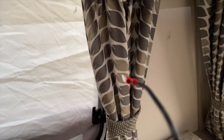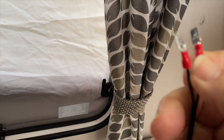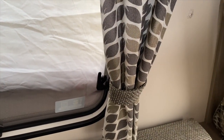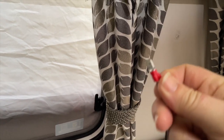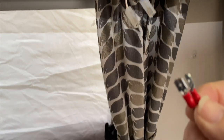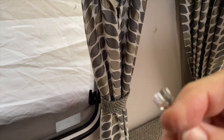Right, I've got the spades on there now. You can always tell positive from negative because the positive cable has got this little line on it. But in terms of polarity, I've checked this already — whichever way around you connect these doesn't make any difference, they work anyway. Now that might not be the same in your van depending on what spotlights you've got, but these do. So I'm just going to connect them up — I can't do it holding the camera, it's a bit fiddly.